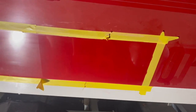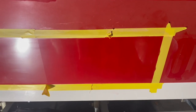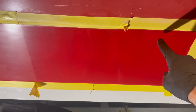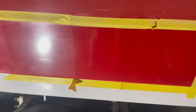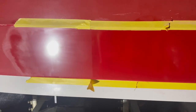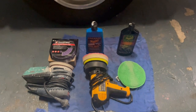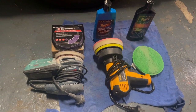After a good polish using both the rotary and the DA polisher, there's pretty much no difference between the area where I used the deoxidizer first versus the area I went straight to polish. But there's a big difference between the area that was sanded versus not sanded, and almost no difference from using the chemical deoxidizer or the hydrochloric acid. So the winners are — no surprise — the process with the most work.